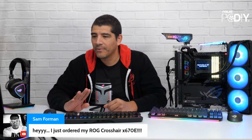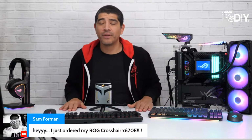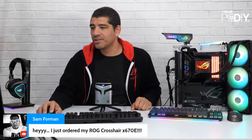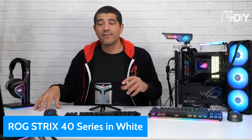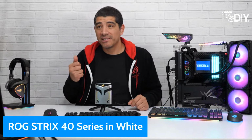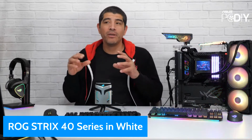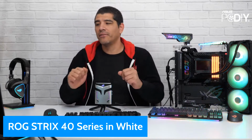Hey, Sam, just ordered my ROG Crosshair X670E. Fantastic, man. The Crosshair is a fantastic board. Really, really sweet. Make sure to get yourself updated to the latest version of AGESA on that board so you can have the best interoperability and compatibility experience. Plus, don't forget to check out a really cool feature that we have on our ROG series of motherboards called ASUS AI OC that we have specifically for X670. It allows for some really cool things that we have built in, such as automatic curve optimization. You have PBO enhancement, which allows you to target different temperatures, along with PBO, which is an opportunistic boosting technology. So some really cool features that you have available to you on that board.